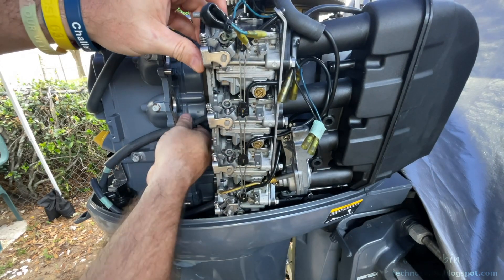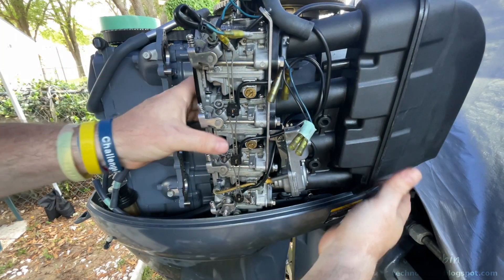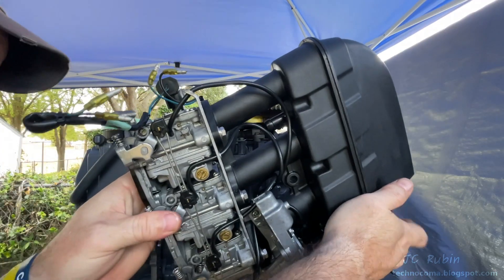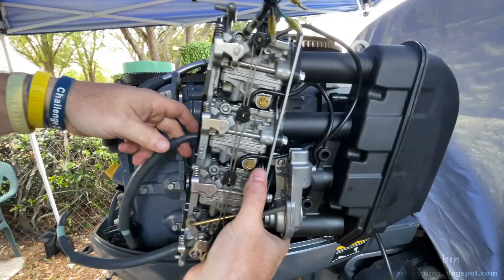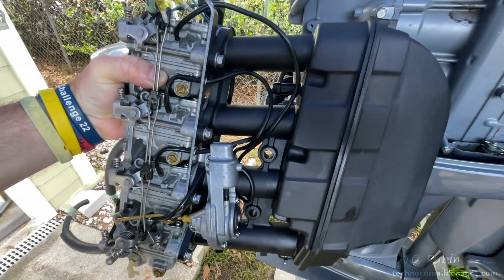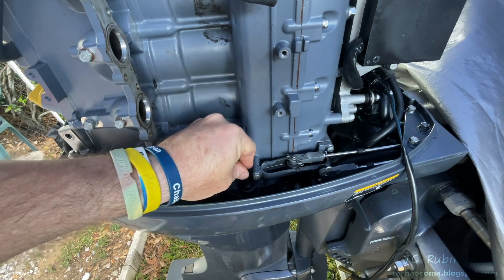It's like a line within a line, so I give it some slack. Up top is a cable harness holding those electrical cables, so I disconnect it from the air silencer. And now the whole entire carburetor pack comes right out of the engine with no problem at all. We can see on this model, the carb was removed with the accelerator pump intact. The very first thing I do is put the dipstick back in before something falls in that hole.